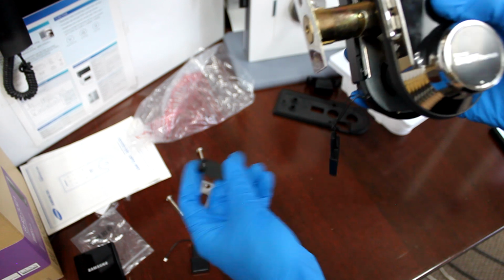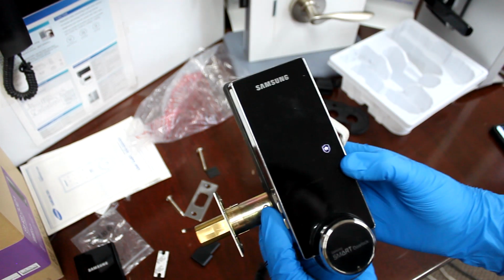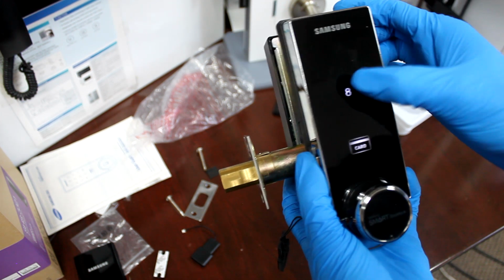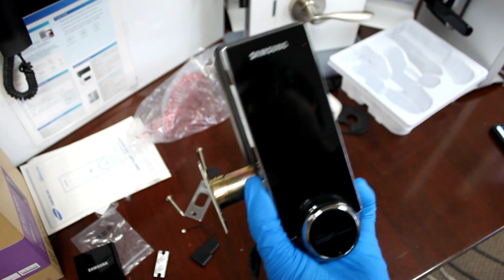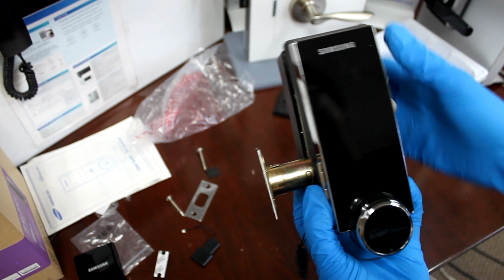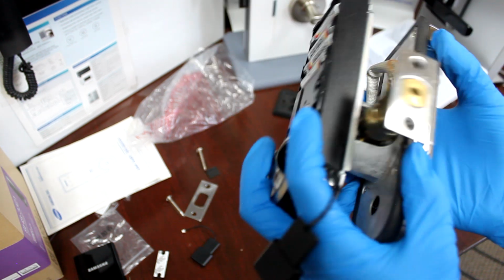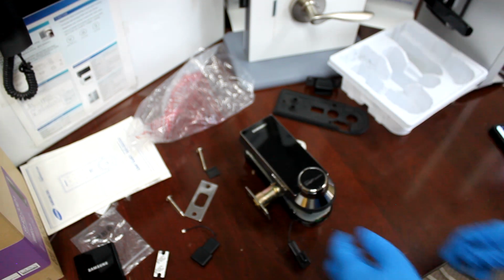check it out. Touch once, now you're not going to get the beeps anymore, and now it's locking when you touch the screen, and you are getting a prompt for the passcode to unlock. That is how you troubleshoot your, oh my goodness, my door lock is unlocking when I touch the screen, and having to put in the password to lock it, which, you know, defeats the purpose of a door lock. Alright, next feedback.